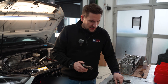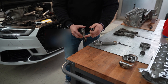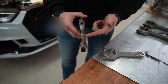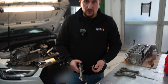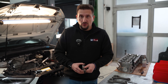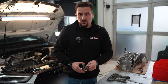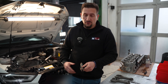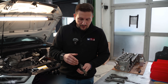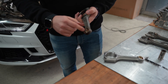We want to prevent this disaster with your car. This may happen for two reasons: on one hand, because you are using too much torque on the stock rod, which is not designed to handle more than 800 Newton meters over time. On the other hand, some customers are driving with ethanol content fuel on stock engine internals, which generates too much combustion pressure and causes these damages.